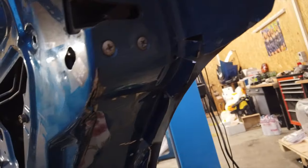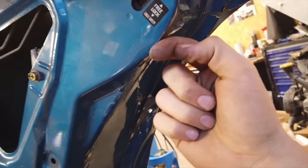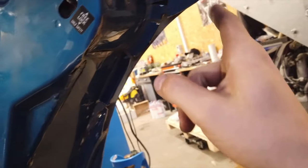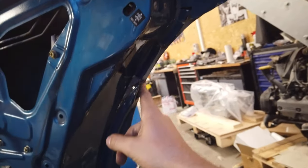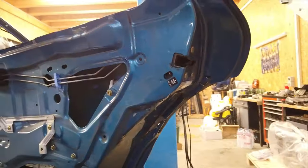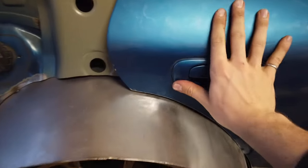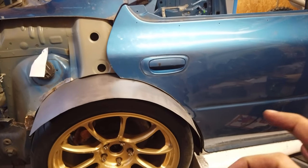I just need to patch this area in the back and clean up some of the welds. Looking at the door — I haven't welded it yet but I've finished pushing this part of the metal in. I still need to cut a little bit here, but I also had to cut a bunch of the door here, about two to three centimeters. The good thing is that now everything fits, so I can actually go ahead and close the door and everything lines up perfectly.